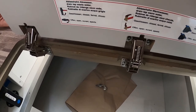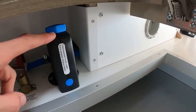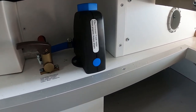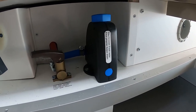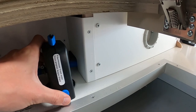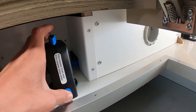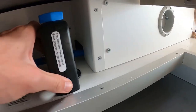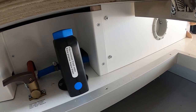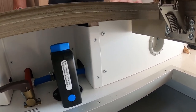Underneath the main flap when you come in the entrance door, you've got storage, but also your frost control for the boiler. The boiler holds 10 litres of water at any one time. In winter it's crucial that no water is left on board, as it can split tanks, crack pipes, and ruin boilers — which are very expensive to replace. Open this, the button will pop out and you'll hear water cascading underneath the van. Leave this open the whole time you are winterising. When you come to re-commission the van, turn it horizontal, push the button in, fill the vehicle with water, come in, put the pump on, bleed it through — cold first then hot — it will cough and make all sorts of noises until you get a steady flow at each tap. Then you are primed with your boiler.